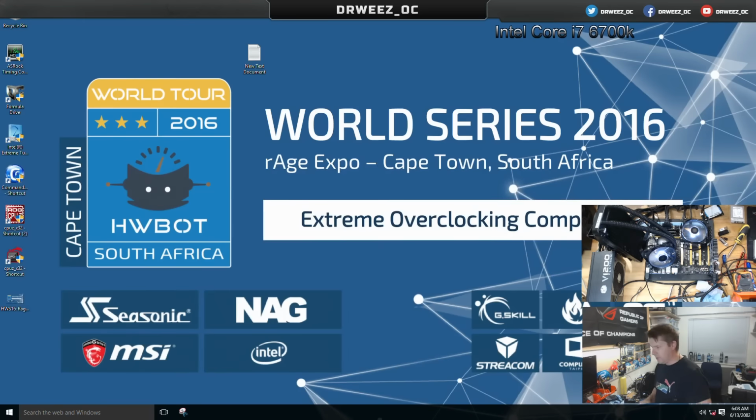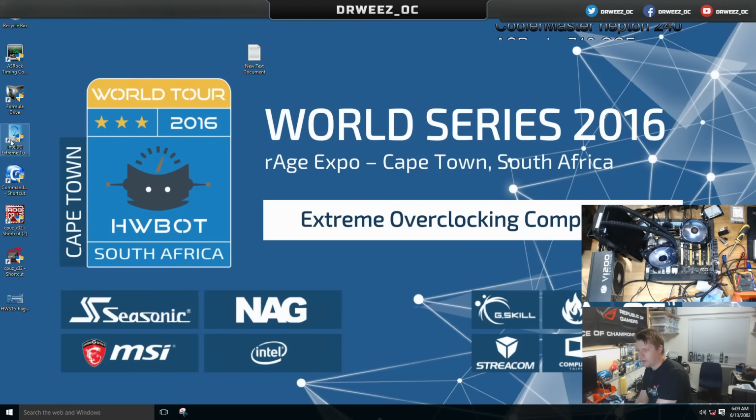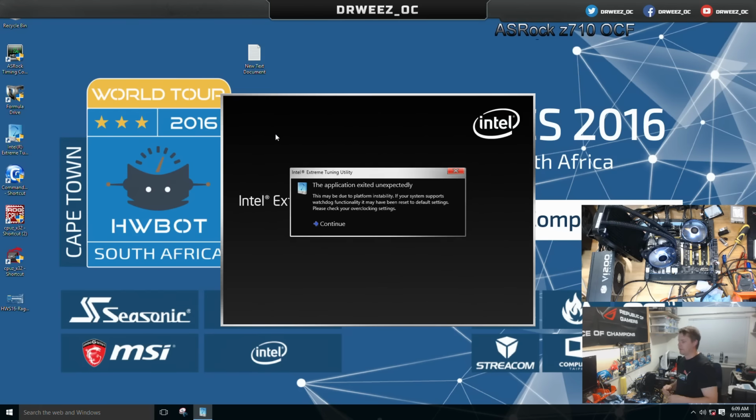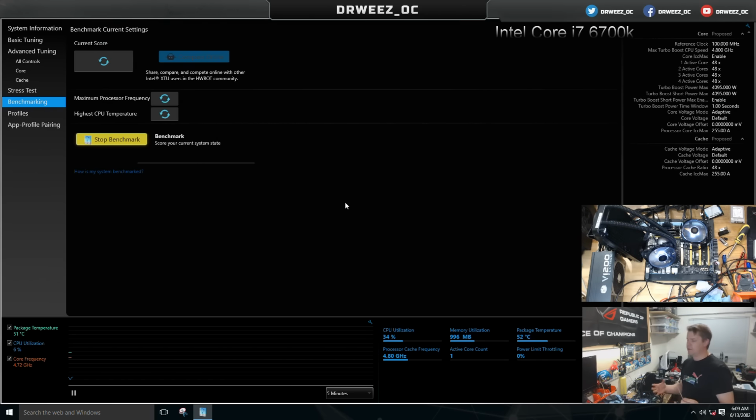Okay, so I have got another tip for you, which will be my tip number 6, which I have just broken, and that is change one thing at a time. It also just helps with the fault finding side of it. So don't go in there and change the CPU voltage and the SA voltage at the same time. You know, go and work with the CPU, then work with the memory, and try and limit the amount of factors that come into your fault finding expedition.